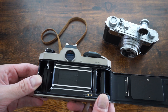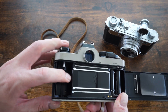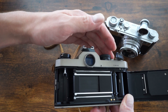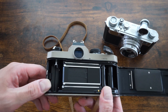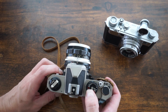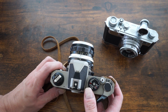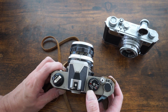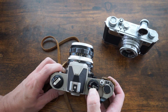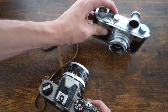SLRs have a different shutter style — I believe it's called a focal plane shutter — with little metal blades that move up and down, opening just enough of a gap to let light fall onto the film plane. Because they travel a shorter distance, SLRs generally have faster shutter speeds. Many older ones only reach 1/500th, but most Nikons go up to 1/2000th, many to 1/4000th, and some even to 1/8000th of a second.